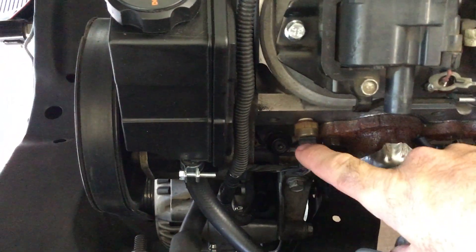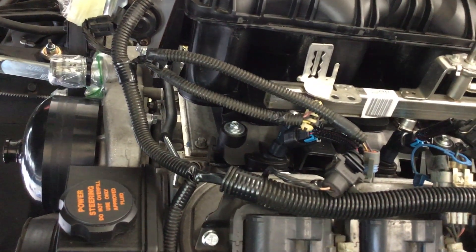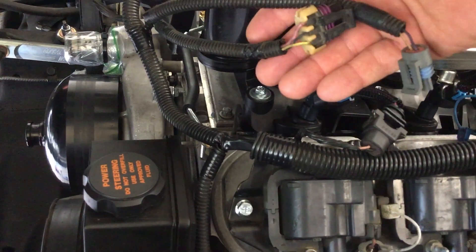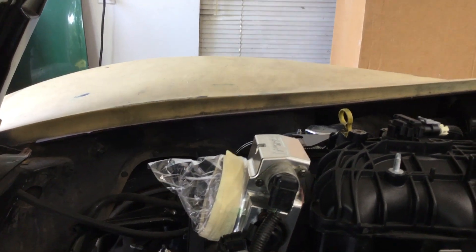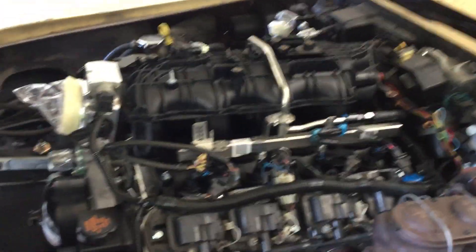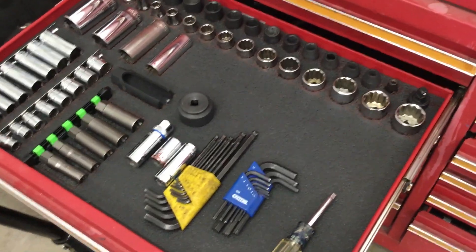With my wiring, I do need to replace the cooling temperature sensor, but I've got the alternator wiring hooked up at the bottom - somewhat temporary-permanent. My inlet air temperature sensor and mass airflow sensor are still disconnected since I don't have the intake in at this point. The pigtail harnesses are in and everything is hooked up. I'm doing this stuff when I have spare time, also working on organizing my toolbox.